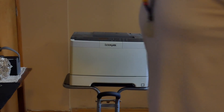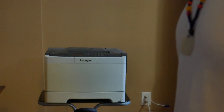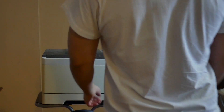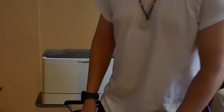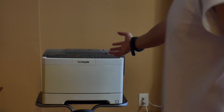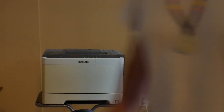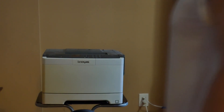One of the common issues you have with these types of printers: the tray isn't picking up the paper, you run out of toner, the fuser assembly is not working — which is in charge of heating the paper — you get streaks and lines on the paper, paper is not being picked up by the pickup rollers, and you have to use a maintenance kit. I'll show you a couple of cool tricks.